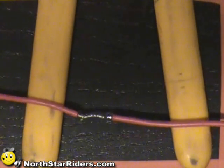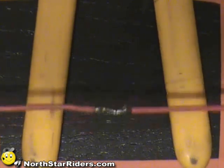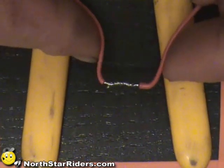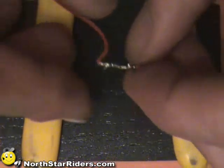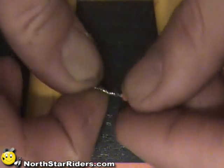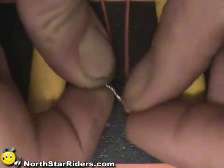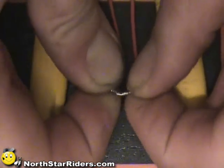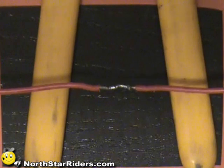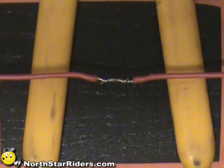It should melt in just like so. After it melts in, you can see that's a pretty clean looking solder joint — it's all the way around there and it's melted in. This is a very strong wire. You can notice that it is a little bit stiff in the area where the solder was, so if you bend this enough right at that joint it will break. This is a smaller diameter wire than you may or may not use, but that is a butt connection.